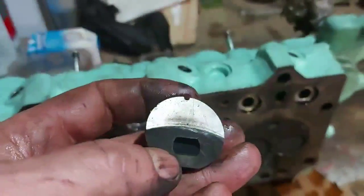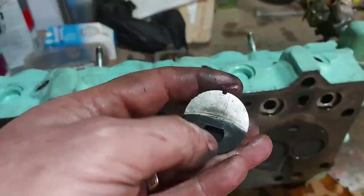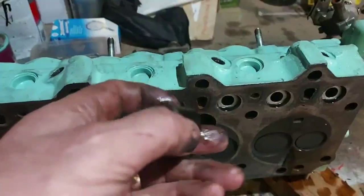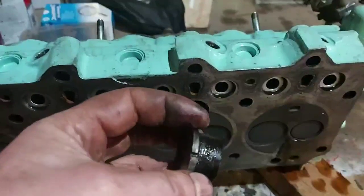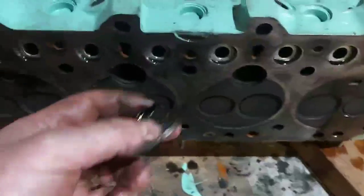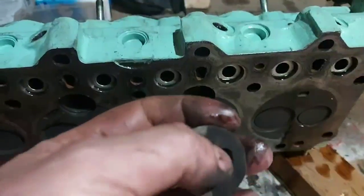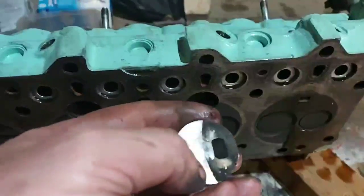You can see the hot spots have got little cracks in them. The engine will run perfect with those little cracks in, but eventually what you have to be aware of is they will travel, and then bits will start falling off and dropping into your engine. That's gotta come out. It's covered in oil because it was underneath the cylinder head when I took the head upside down and all the oil dribbled into it. That one is probably the worst — it's the one where the shroud dropped into it. I wonder if it got a bit hotter with it not firing properly and not burning the fuel properly.